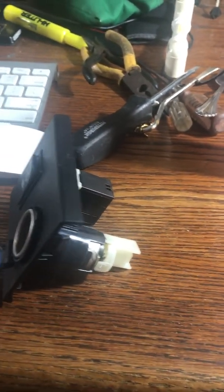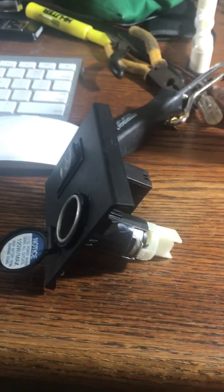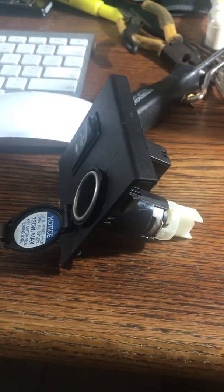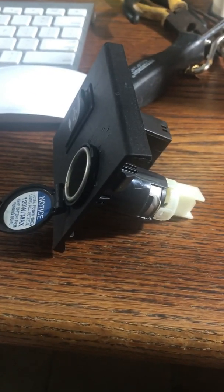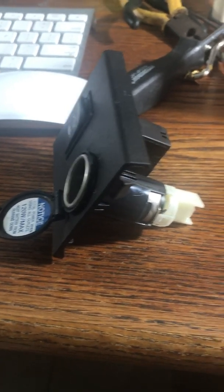And so I'm pretty confident in it. Two-part epoxy, by the way, is a thermosetting, which means heat won't really have that much of an effect on it. All the plastic parts around this thing are thermoplastic, which means they'll melt. So the glue is actually more heat resistant than the plastic parts all around it.